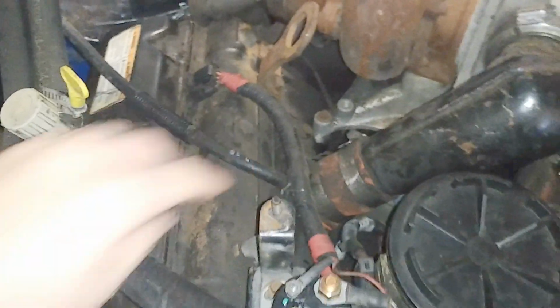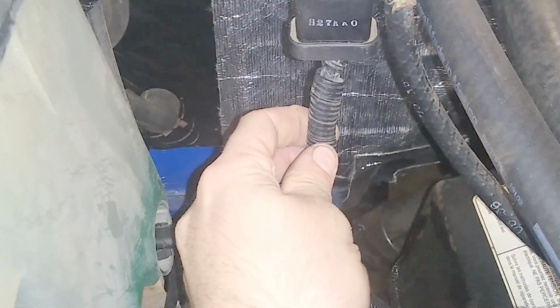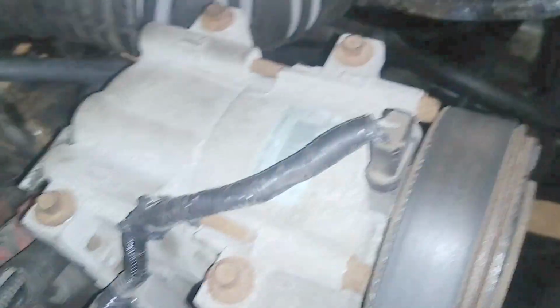On the passenger side of the engine, there are a few circuits you will want to keep. You need to keep the 3 wires that run from the ECM to the map sensor, the big wire for the alternator, the 2 small wires that turn on the alternator, and if you want to run AC, the power and ground wires from the AC clutch switch.